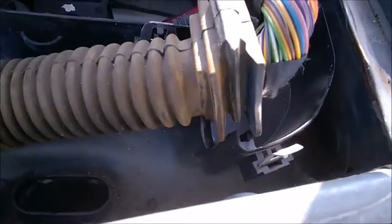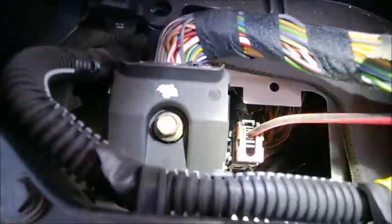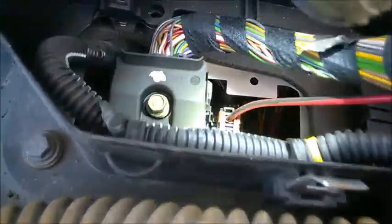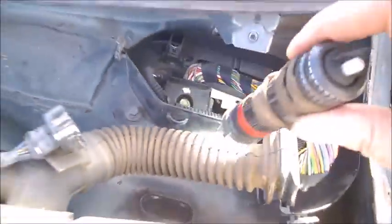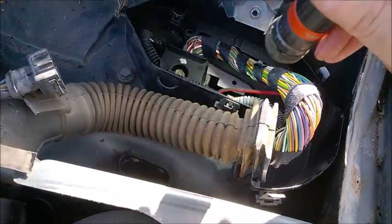The cable is passing through an almost open hole really close to the bottom, but there is a big rubber grommet with like three parts on it. So perhaps this is sealing properly. I don't see on this car any water leaks or traces, and there is no corrosion. I think one of the things that may have helped is that the design of the CEM makes it not sit directly underneath the opening — it's more towards the front of the car. So if the water comes to leak over this opening, it's not going to leak over the CEM or even over this connector. There are just cables underneath — no electrical components. So this was perhaps a safer design, and then Volvo updated and put a new type of CEM with a completely different design here.